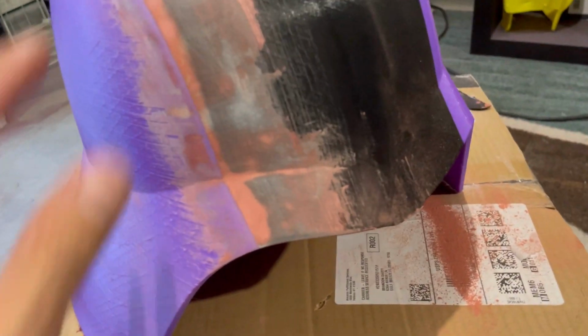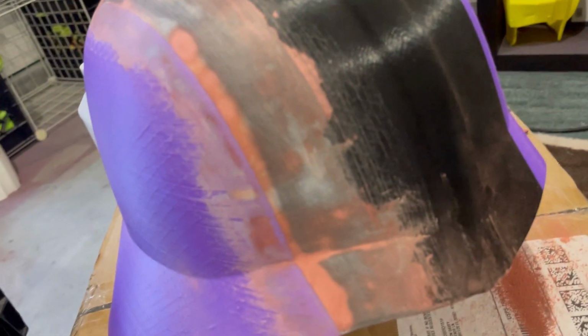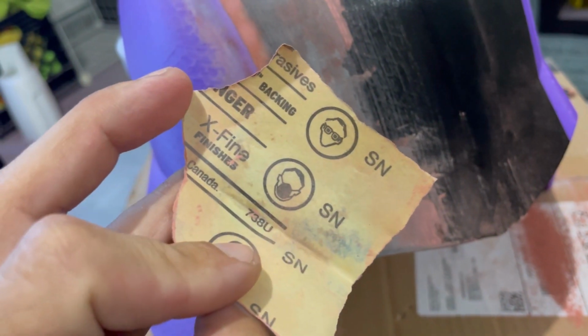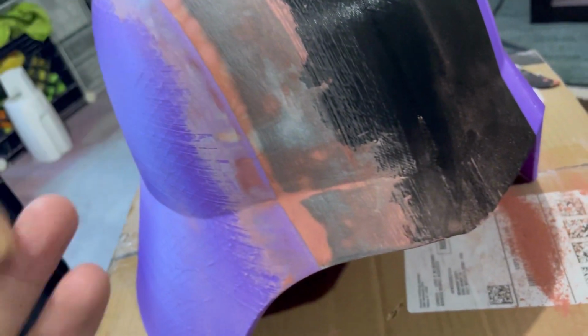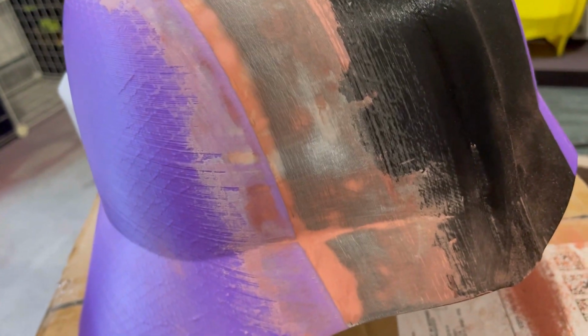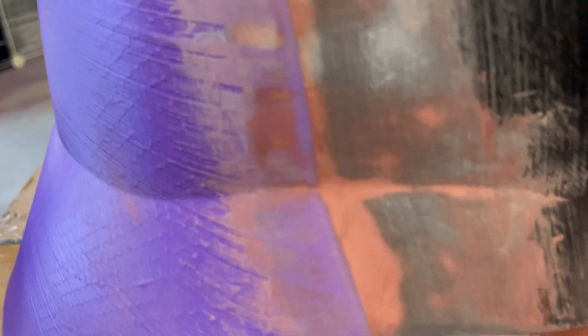Sanding, and it is very, very smooth. Now, what I did is I only sanded the glazing putty with 320 grit, which you can see right here. Extra fine. The 320 is ripped off, but trust me when I say it's 320. When you do glazing putty, you don't need to use a very heavy grit. It's very light.